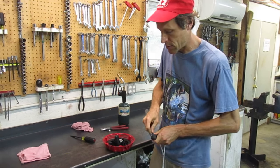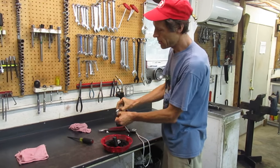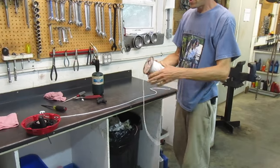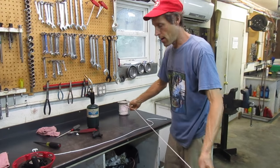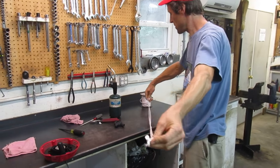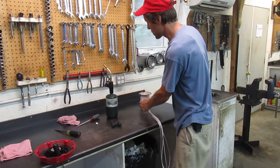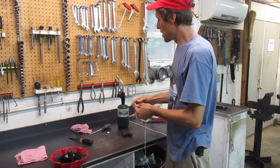These handles are fully reusable — they usually just have a plastic insert in the rubber. You don't need a new handle just because you need a new rope. Here's a new roll of rope; rope is just sold by the foot typically. Anybody selling it in cut lengths is just cutting it off a big roll and charging you more. I'm going to match up the length — this should be about five feet; I'll go about six inches longer than the original.